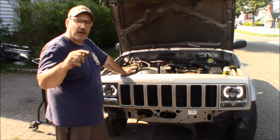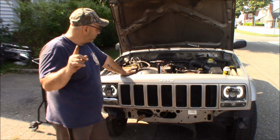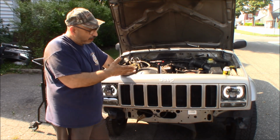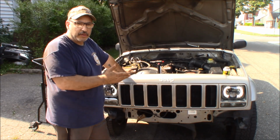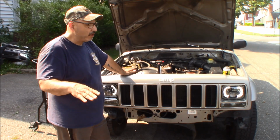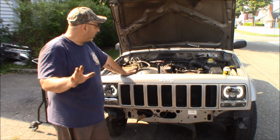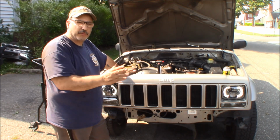So I'm gonna have to check a diagram, see what fuses they are, but if they are the right ones, meaning that I could draw the, you know, 1/2 amp probably that the daytime running lights will draw, that's a great one, because it's only going to be on when the car's running. So as soon as you turn the car off, daytime running lights go off, the car's got to be running for it, which would be pretty good. But I'm going to check those 2 fuses, and I'll be right back with you, and then we'll get the rest of this all buttoned up.